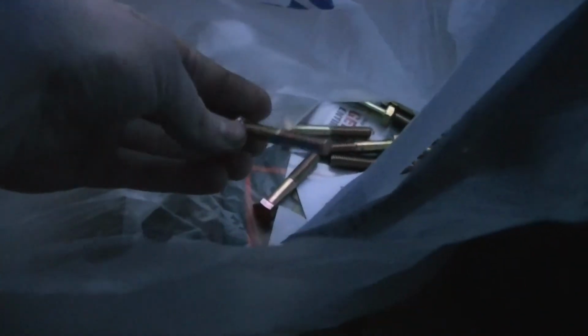Alright, morning tubes. I'm gonna head up to Fastenal, a little hardware store that we have. It's kind of like the Walmart of the Ace Hardware. It's a little bit bigger. They got more stuff. They've got some good high quality vacuum line that I need. Basically, we're replacing the brake booster hose, and we're replacing a whole bunch of vacuum lines that run all the emissions, and including the lines that run the 2 ends that connect the steel line going to the transmission. Alright, we got some new intake manifold bolts.